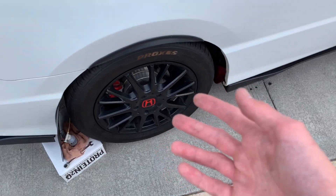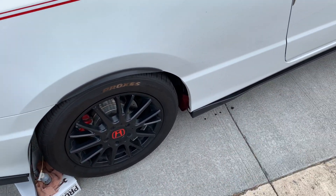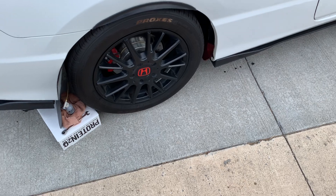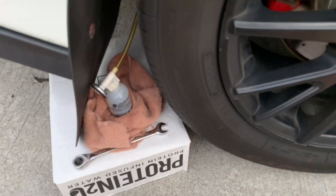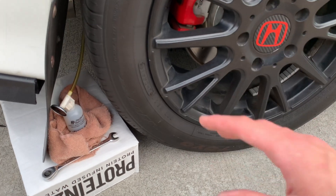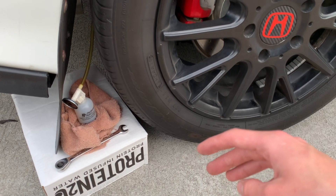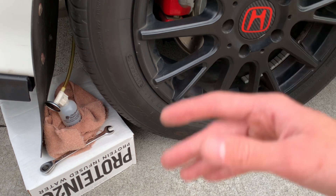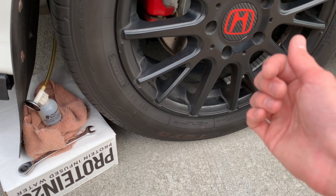The reason you want to replace your brake fluid is to either get the old fluid out — to flush it — so that your car brakes better and doesn't have as much corrosion going on inside the lines. In my instance, I'm getting the air out using the gravity bleed method.